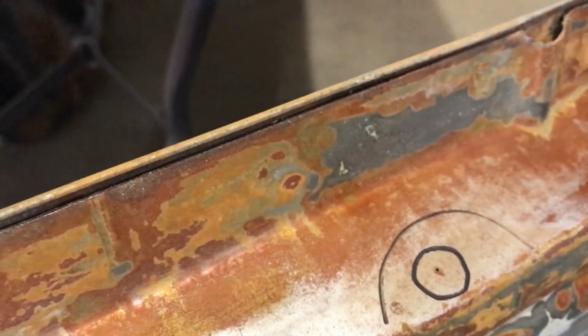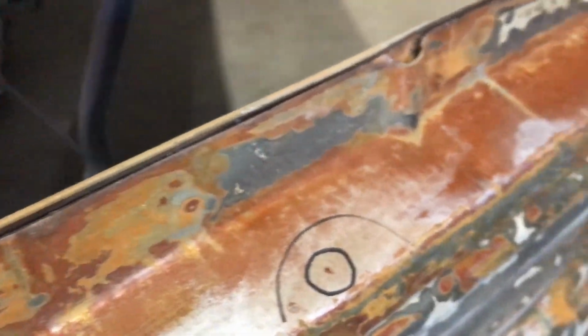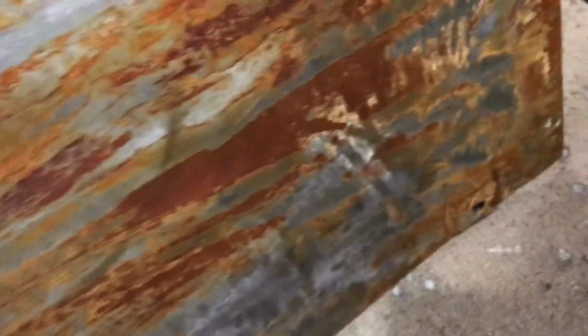It's a bit of a stress fracture there. I'll get it out, a little bit of rust there, and phosphoric acid it, and then primer it. And there'll be no more welding once I've got it primed, so it won't get burnt, because that's what's been happening before. I'd phosphoric acid and prime it, and then when I'm welding it, I'm burning the primer, and it's just going around in circles a bit. The outer skin is pretty good. A little bit of drama there.